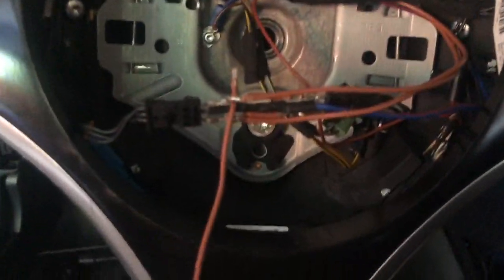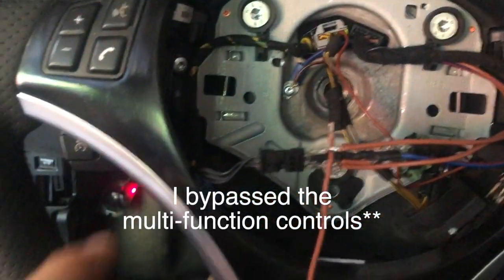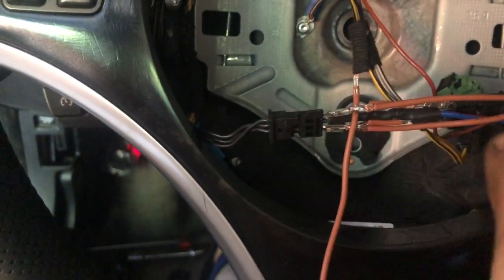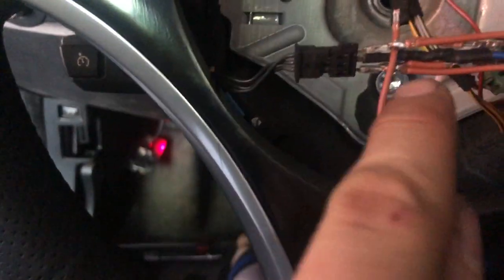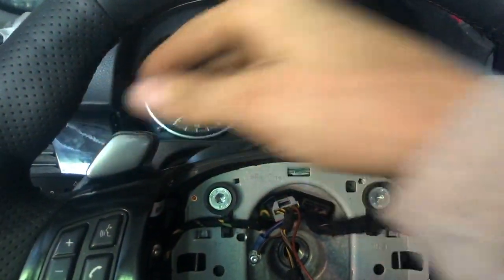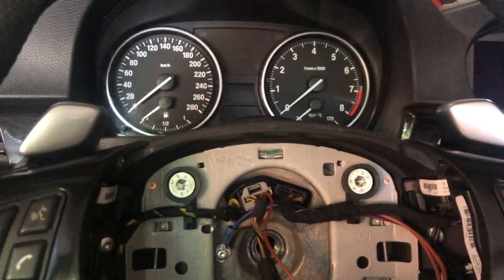We're done. I'm going to clean this all up and make sure these are nicely insulated so I don't get a short. Basically I just bypassed the paddles — we're running into four and six, and then you've got to run to ground. I've got a ground wire which is the middle pin on each of the paddle connectors. This one handles the upshift, and then this one's the downshift — but I can also push to do the opposite. So I've left it fully wired up, and there you have it.